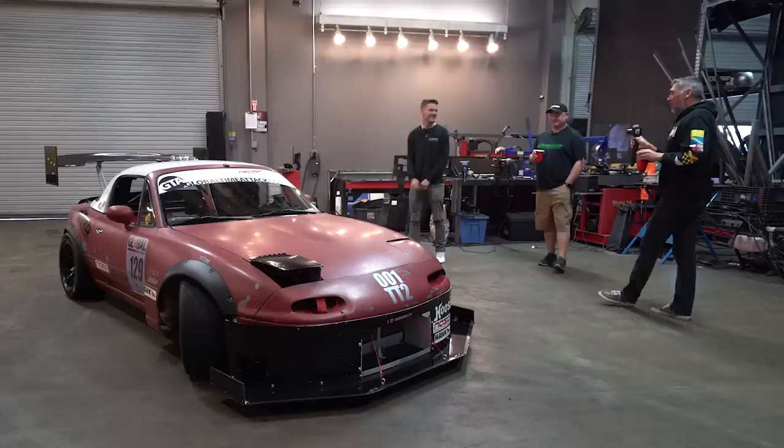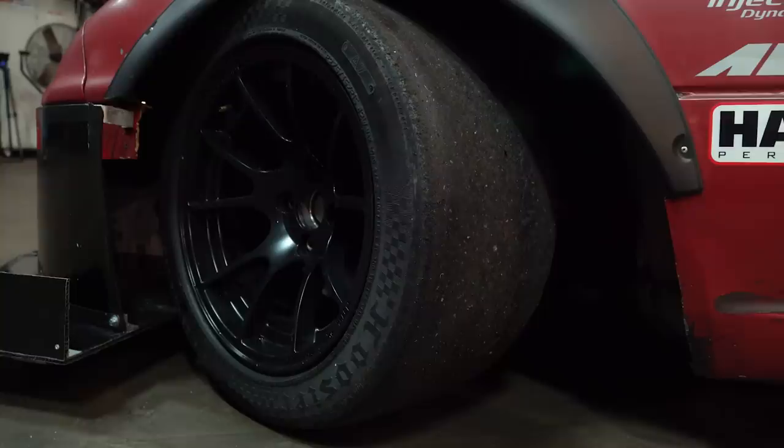Before we get to the back, when you talked about your tire widths, you're running square 275s. 275 squares, right? Hoosier A7s. Yes. So why the A7s instead of the R7s? A7 is an autocross compound, so it's stickier. Softer, comes on faster. Exactly. Everybody sort of runs the A7s. They don't last as long, right?